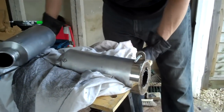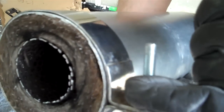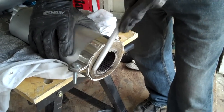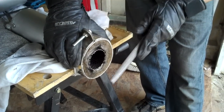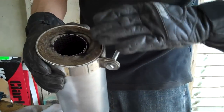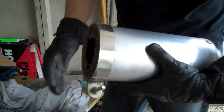Now let's see if we can get that cap off. The cut end is controlled and the strap is perfect. Where the saw's gone, it's not quite perfect so I'm just going to file that so I get a perfect round - when the cap goes back in I need it to be perfectly correct. That's got it completely level now. If you've got a carbon can and want to do this, the trick is to use two big jubilee clips around it - they'll hold it in a circle so it won't squash as you saw down, because carbon fibre is flexible.